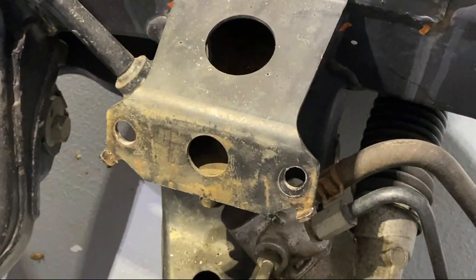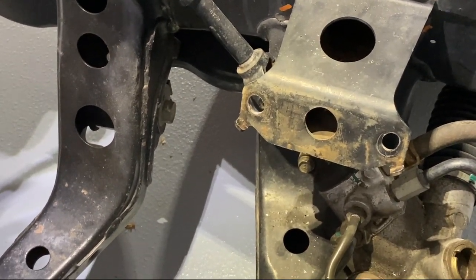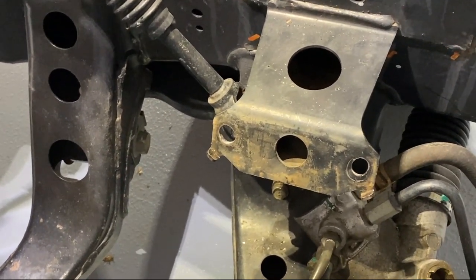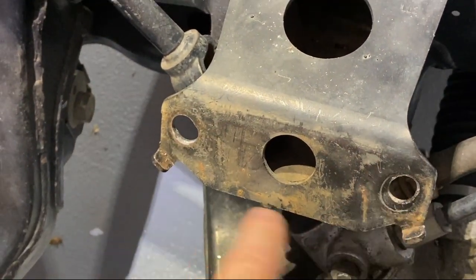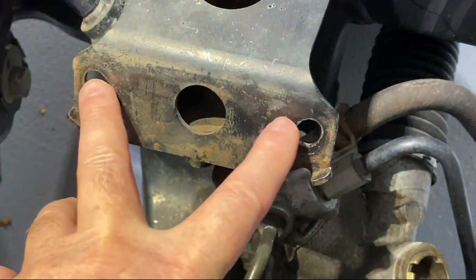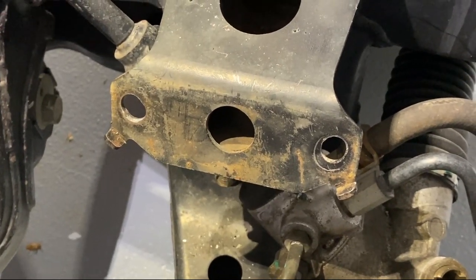This is looking at the driver's side motor mount. This is a truck equipped with the four-cylinder engine, so I'm not sure what the V6 mount would look like or how much different the four-wheel drive version of the frame would be. But I believe the mounts would be the same on the four-cylinder. You can see there's two holes here and then these tabs — these tabs are kind of in the way. I'm going to need to get rid of those. I've got some plates that are going to fit over this and mount using the two factory holes. These little metal tabs need to go.